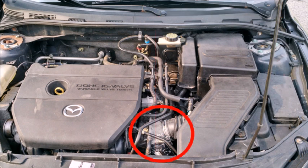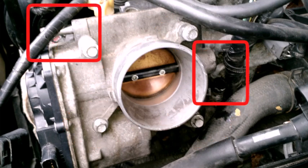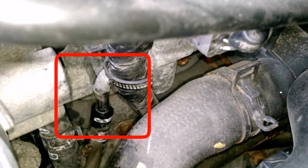With all of that out of the way, we can dive into the throttle body. With the duct out of the way, we have access to the four 8mm bolts that mount the throttle body to the side of the engine. The bolt ends may be a little rusty, so be careful when removing them. After disconnecting the four bolts, there are also two coolant lines that you will have to disconnect. The port on the upper left can be removed at any time, and you may find it easier to remove the port on the right after having removed all four bolts.